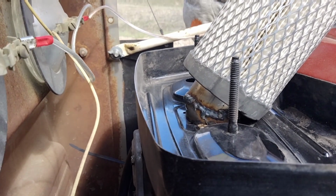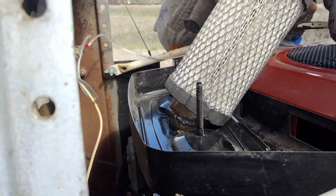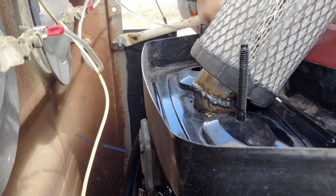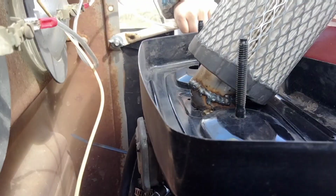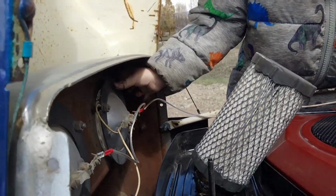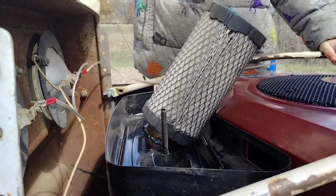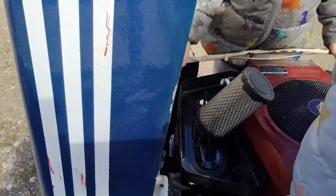custom air filter holder. I had tons of these trays for holding the stock air cleaners, so I decided to take a chance on one, and I cut 2 pieces of exhaust pipe. I believe it's 1.5 inch diameter, and welded them at an angle. The hood clears, and got good air. These filters are cheap enough, 16 bucks a filter. I got a better, cooler looking, like cold air intake for a motorcycle filter coming.